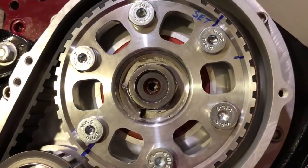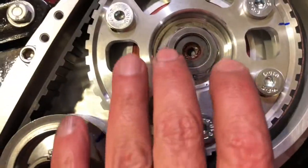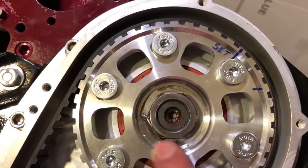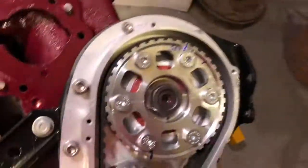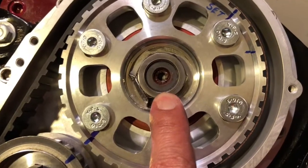And thanks to the miracle of video, just like that, it's all together. This is the second time I've used a little trick here. If you take a look at the size of the standard camshaft nut, it approaches this bore size. As a result, there's probably better sockets, but our 1 5/16 simply does not fit within this lovely sprocket. This nut is a Minis input shaft nut from the transmission.